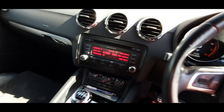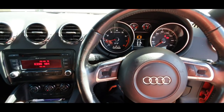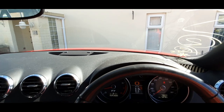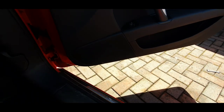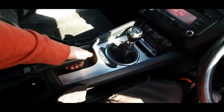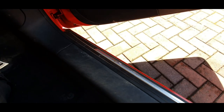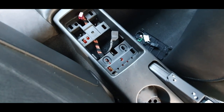I'll leave all that off and I might have to adjust it. Let's see if she pulls off the drive. Brakes are solid — handbrake down — let's see if this baby moves. She moves all right, and she stops. Let's see if she holds on the handbrake. It's still pretty loose — let's see about adjusting that handbrake so it's a bit tighter, because you could end up wrenching it right up and stretching the cable. It's holding lovely on there. That is how you adjust the handbrake cable.